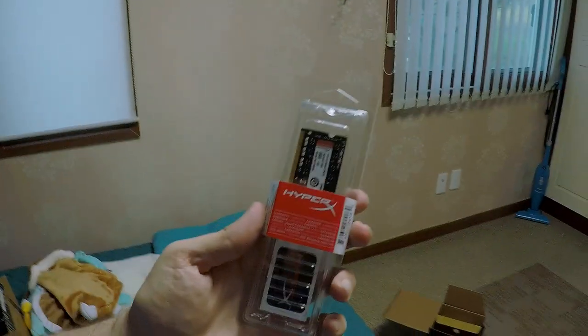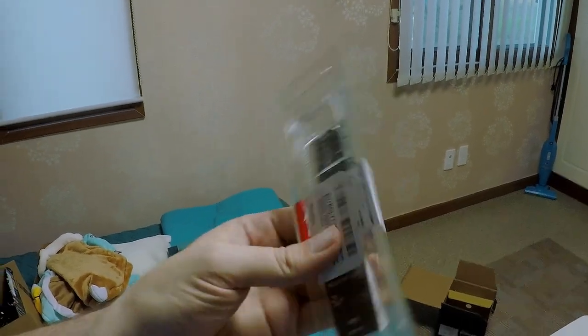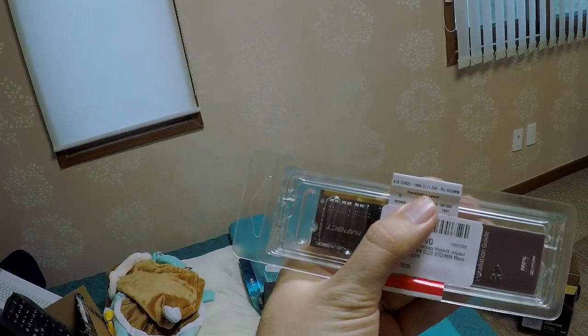I've got the box assembled. There was one minor catch in that apparently one of the sticks of RAM I was sent is DDR3 and not DDR4. Therefore, it won't work. So right now I've got 8 gigs in single channel mode instead of 16 gigs in dual channel mode. But that'll still let me get it up and running and test it. I will just have to file a return and get a new one sent out.